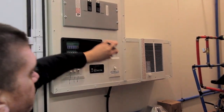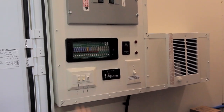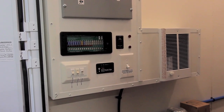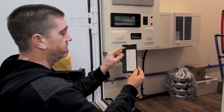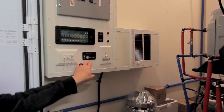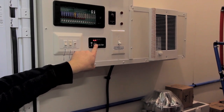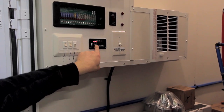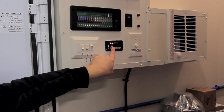You have your 12-volt fuse panel located right here. Anything that's running through the converter is going to be coming off this 12-volt fuse panel, so if you have any issues, this is where you're going to want to go. Again, this is labeled and shows you what each of the components are for. You have your tank sensor right here — this will give you an indicator of the level of your waste tank. Just push the button down, hold on to it, and it'll show you on the lights there that you went from empty to a quarter of a tank.